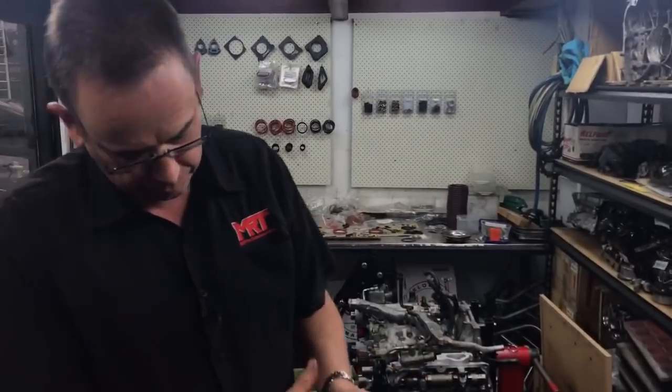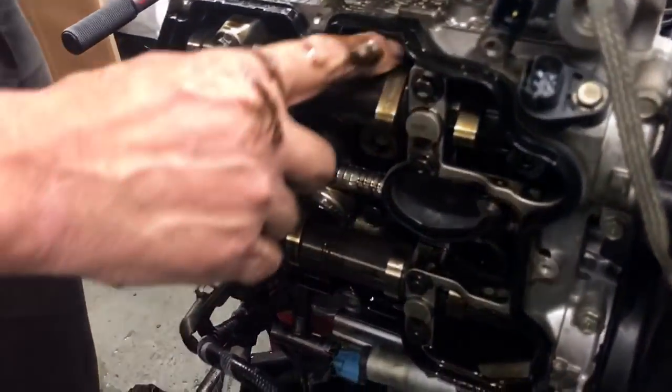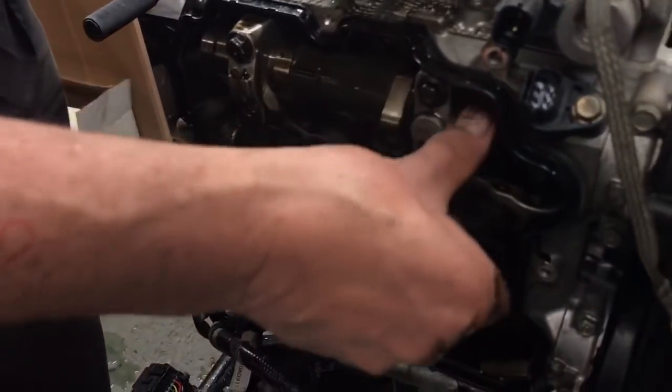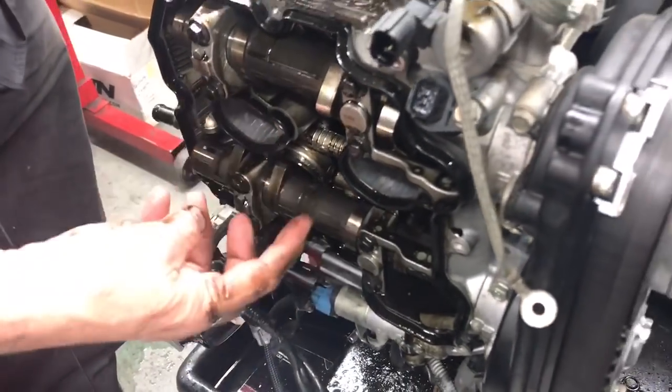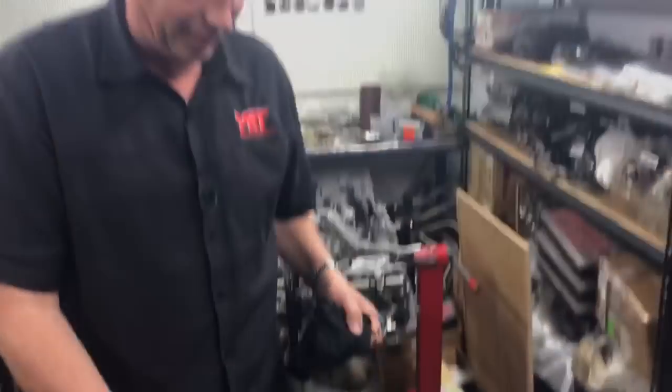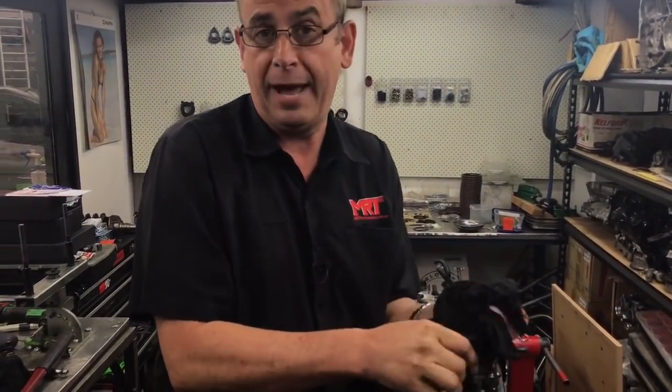At the moment we're going to stop right here. The good news is we've pulled the tops off the rocker covers and you can see there's no mechanical damage done to the camshaft journals, thankfully. We don't know until we pull the cams out of the bearings themselves, but we do expect the inside of the combustion chamber on the underside of the heads — where it matches the bore and the block — to be pretty badly damaged. We just don't know whether we can save the heads yet or not.